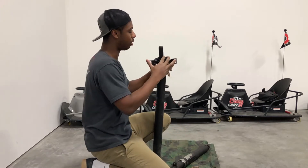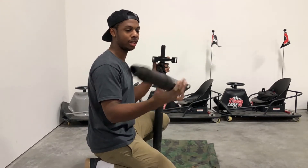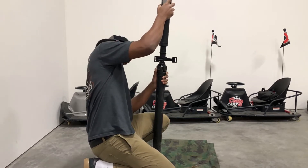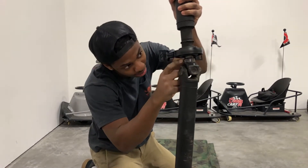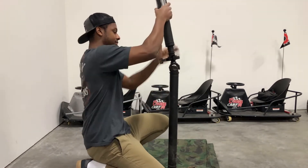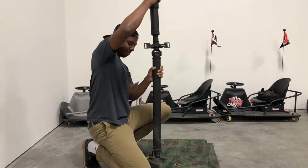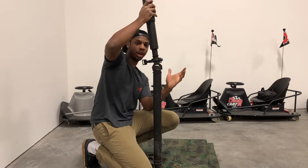You usually get a tool or something to hammer it down on the pin, but I don't have one, so I found a little hat. You take the top part of your driveshaft - some people might think I'm stupid for doing this, but it's the best way I can think of right now. Take that, slide it on the back down. See that there is a gap right here - that's where the driveshaft center support bearing is supposed to be sitting. Take it like this, make sure there's enough on there. Some people might think this is really bad to do, but that's the only way I can think of.